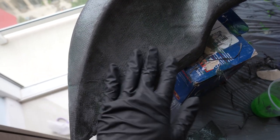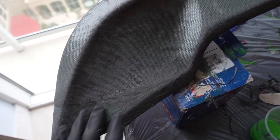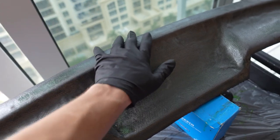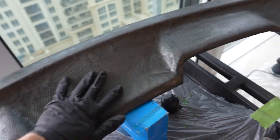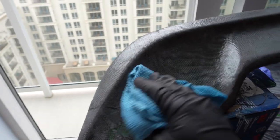This right here is the finish that you're looking for. You can see these strands right here because I accidentally cut the cloth a little bit too short - no big deal though, I don't think you're really going to be able to see it, especially with that green tint. This is all smooth. What I learned from a tutorial on how to skin carbon fiber is that when you hit it with 120 grit you want to make sure the wing is completely smoothed out so that you're ready for the next steps of resin. I'm going to wipe the wing with a damp cloth one more time before we do more resin.